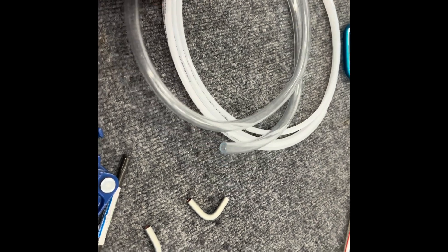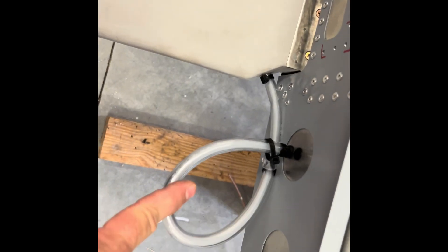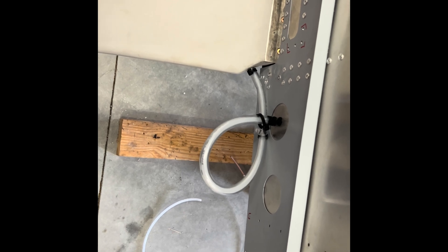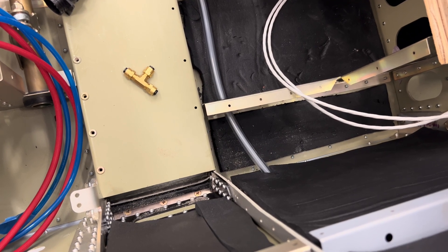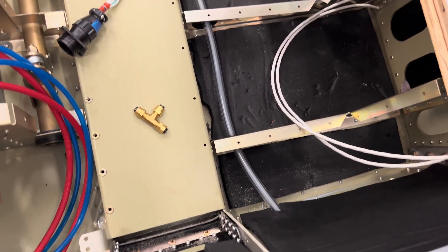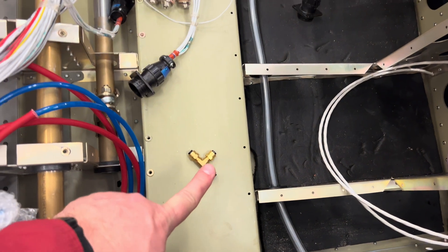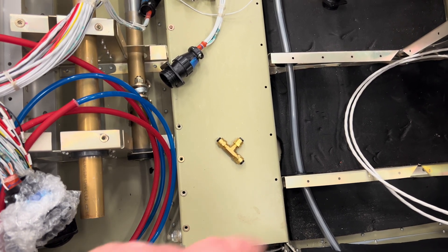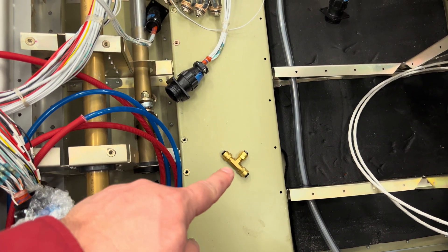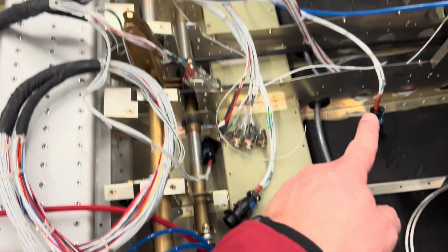I actually bought some more of this thicker protective sleeve that Sling gives you — I bought an extra 10 or 12 feet because I want to coat it everywhere. On the inside of the plane you can see where the tube comes in from the sidewall and then goes to the centerpiece, and that's where it ties into the T fitting. The T fitting is particular because I have the handbrake — I do not have the toe brakes. If you have the toe brakes you'd have independent left and right, whereas mine are tied together for simultaneous braking of both wheels.